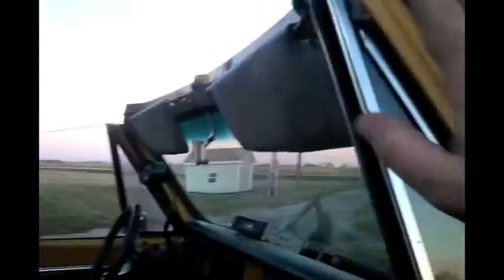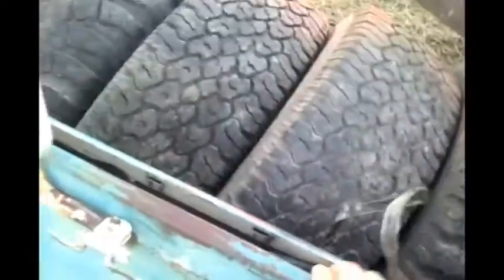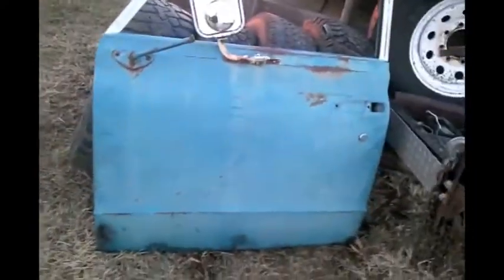I'm probably gonna redo this piece here that they welded in — get the actual piece of floor to weld in. I've got the rockers back there. On the driver's side, I need to get this piece that comes up more. That door shuts really actually pretty good, so I'm not worried about it. I'll worry about the pins when I put that new door on. For anybody interested — these are the same blazer doors as Chevy pickup doors, just with this section cut off. That door in there was one of these doors.